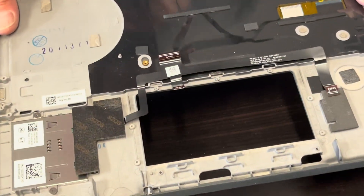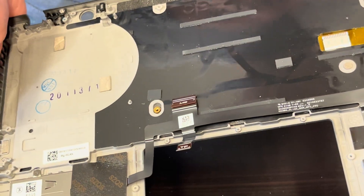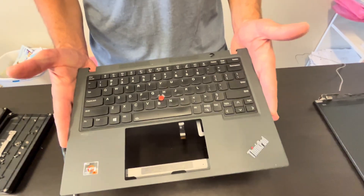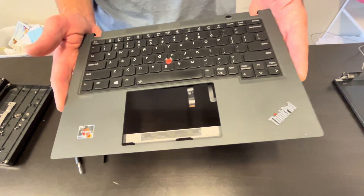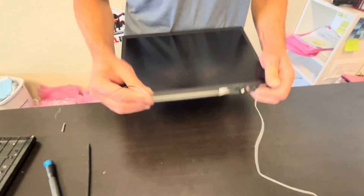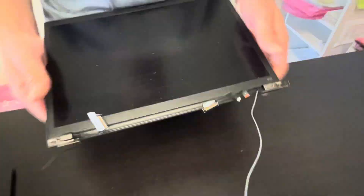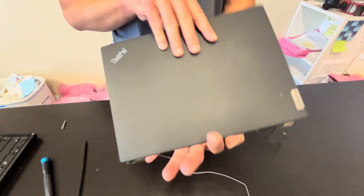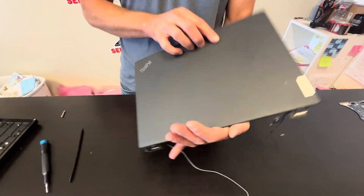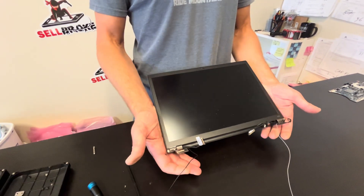That's our keyboard and palm rest assembly. Looks like the keyboard is probably glued or riveted to the palm rest and cannot be replaced separately, so if you need to replace the keyboard, look for the whole palm rest and keyboard assembly. If you need parts, check gotlaptopparts.com. That's our screen — look for the part numbers on the video cables. The screen is very fragile and is usually sold in one piece; otherwise it's easy to crack it when trying to replace just the LCD. Thank you for watching — see you in the next video.